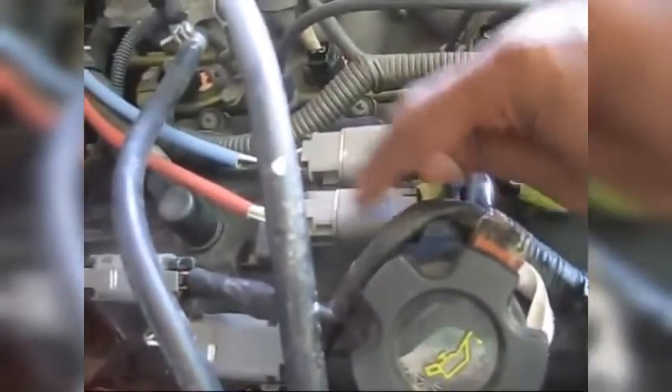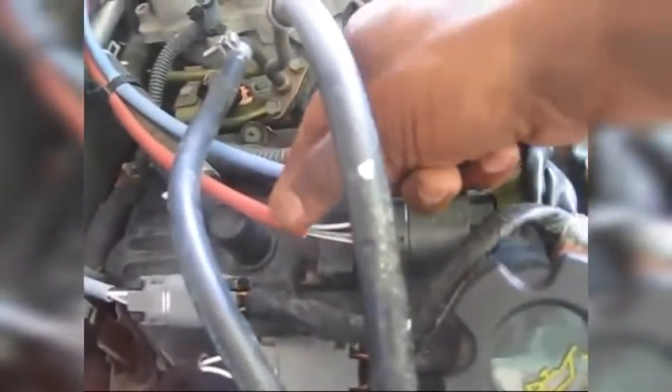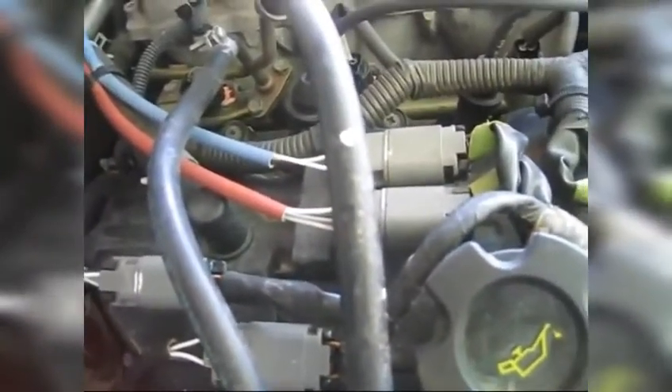This is our primary, this is our secondary. The secondary is with the red cable, our primary is the blue cable. From the color of the cable, it signified that the oxygen sensor on this vehicle was never replaced, or if it was, it was probably replaced with the factory Nissan oxygen sensor. So today we're going to remove the blue cable oxygen sensor.